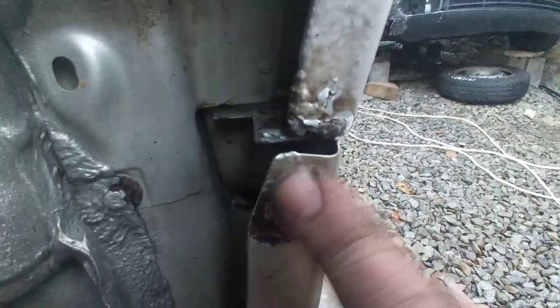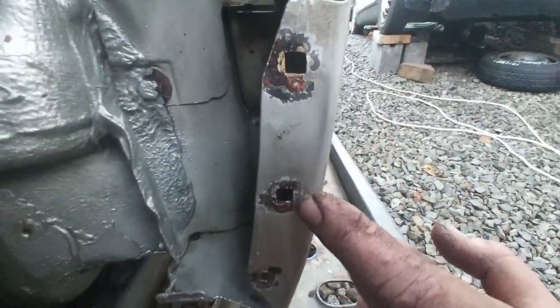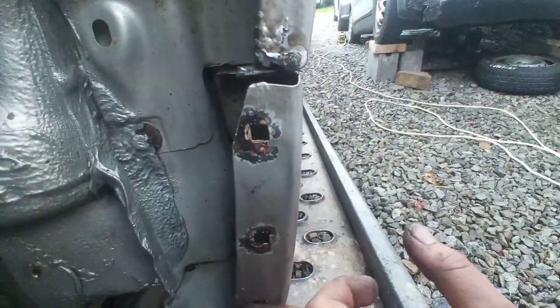You can actually see the two screws, which hold the aluminium part to the steel part, and this is kind of problematic because there is no electrical isolation between the two parts, and this causes rust. So the solution is pretty simple: unscrew these screws. Sometimes there is only one, on the newer cars there is only one screw in here. So dismount it, clean it like this. On the newer ones there are only two holes for four screws.